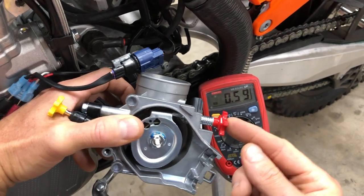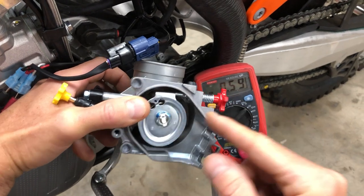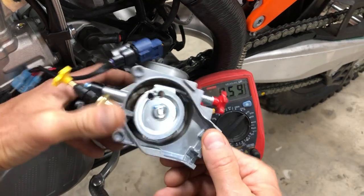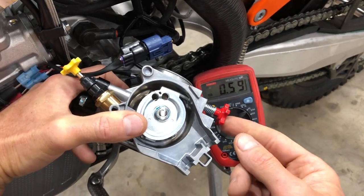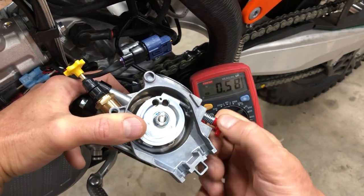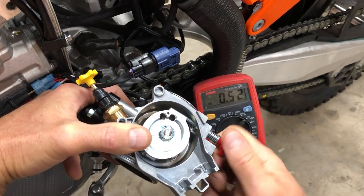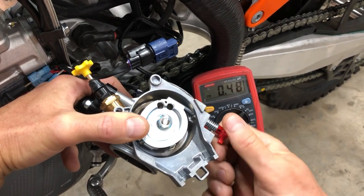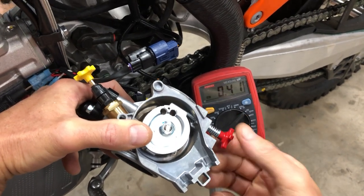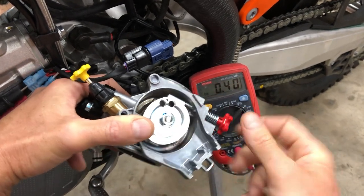So what I recommend is that you don't set this value to a number based on where the throttle knob or the idle speed knob is influencing it. What I do when I set a bike to spec is I will turn the throttle knob. I'm watching the value here. So I'm going to turn the knob out until the number stops. And that tells me that's the point where the throttle plate has gone completely and fully closed, and the rod of the idle knob is no longer touching the cam whatsoever.